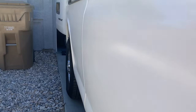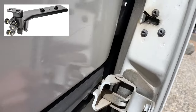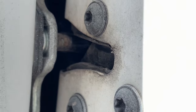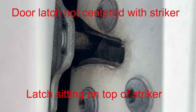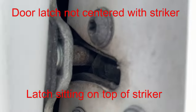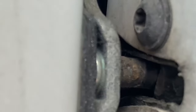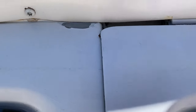There are three roller mechanisms on the door — two in the front at the top and bottom, then one center roller at the rear. The cause of my issues can be seen pretty clearly here at the rear door striker. The worn roller at the rear had worn so much that the door latch was no longer aligning with the strike pin. I also noticed the door would sometimes contact the top left of the door frame — a clear need for either a full roller mechanism replacement or door realignment.